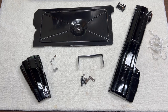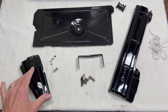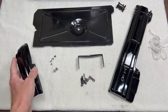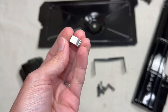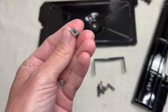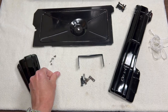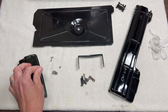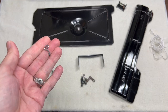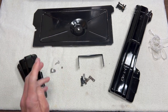For this part of the restoration, let's go over the parts you will need. For the faceplate — commonly called the nose cover — you need the actual nose cover, a little clip called the faceplate catch with a small screw that holds it in place, and one of the thread guides, which attaches to the nose plate with its own small screw.